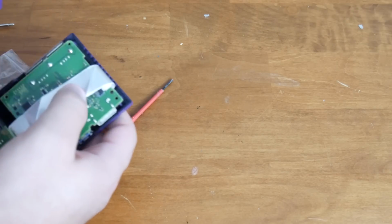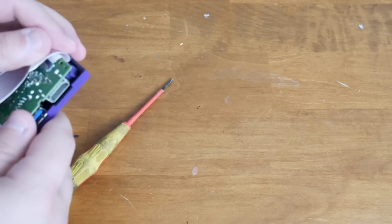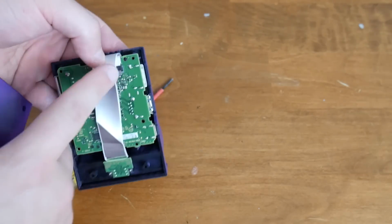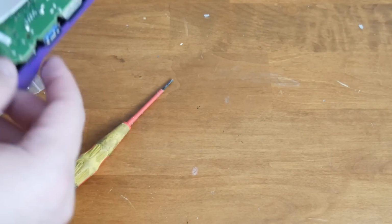Now we have a couple extra screw holes here because, of course, we have 4 on the bottom that are going to hold it together. So we just want to identify where the other ones are that do not need to screw in through there. For example, up here, these two share that screw hole through the board, but the only other ones that use it are these. So all the other screw holes should get their own screw to hold the board in.